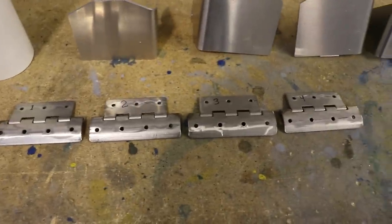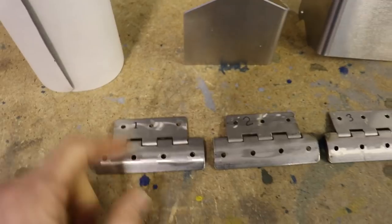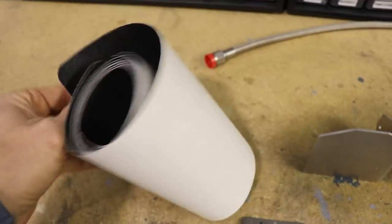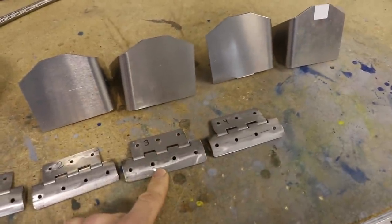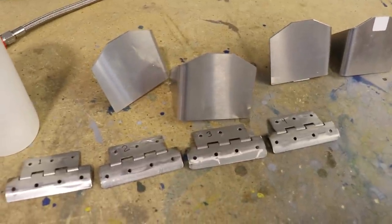I have all four of the hinges done and drilled, and I have them marked 1, 2, 3, and 4, just so I know what pedal each goes on. I can get these primed and painted, and I have my four rudder pedals here. I haven't sanded the edges yet, but I can add this rubber anti-slip tape to the pedals, just like I did on my cruiser. Once that's done and I get my pedals back, I can rivet on the hinges, match drill the three holes for each pedal, and install the pedals into the airplane.